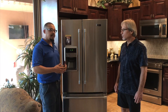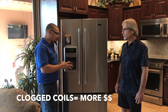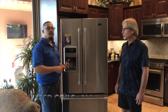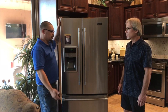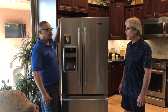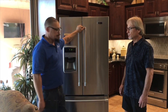If you have pets — cats or dogs — their hair and dander will likely clog those coils, trapping heat inside the machine and causing it to run more often, leading to parts failure. This is the most expensive electronic device in the house. It turns itself on and off, which heats and cools repeatedly, so keeping the coils clean is very important.